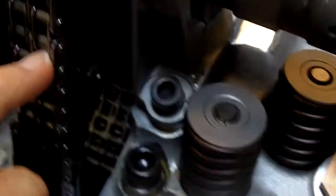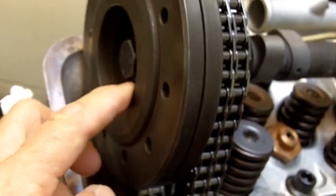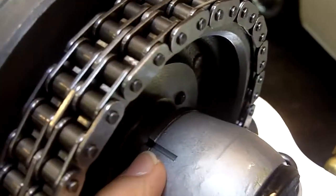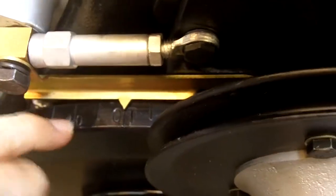All that relates to the timing chain, the thickness of the cylinder head, and the center-to-center distance of the crankshaft to the camshaft, which is a specified distance. So as you mill the cylinder head and it gets thinner and thinner, it's going to alter your timing and change where the timing marks line up. If you ever have marks that don't line up properly, you continue to rotate the crankshaft in the direction of normal rotation until these timing marks line up, then go back to the crankshaft and see how far off it is in terms of degrees of rotation.